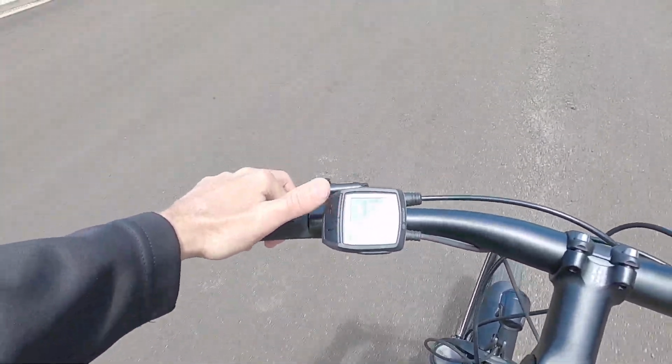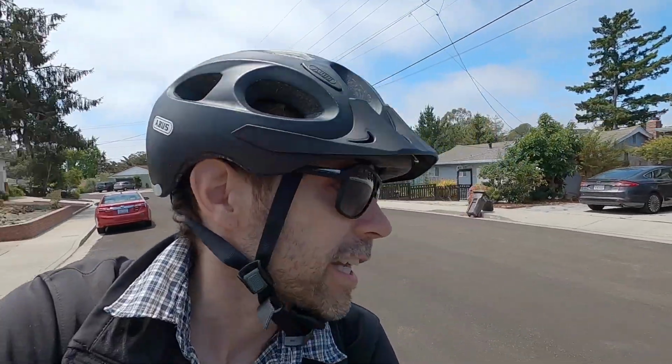If I take it up to turbo, now it might be even more pronounced. Super, super responsive. We've got a regular size chainring here, again 38 teeth, so there's no reduction gearing or anything. It just turns on when you pedal and it stops almost immediately when you stop. However, one thing I've noticed is that it carries the pedals a little bit. There's a clunk feeling sometimes, where if I stop pedaling with my feet on the pedals, I can feel the internal gearing on the motor.